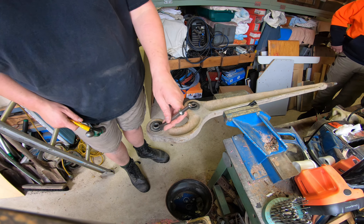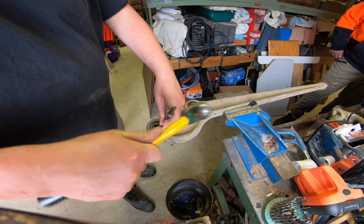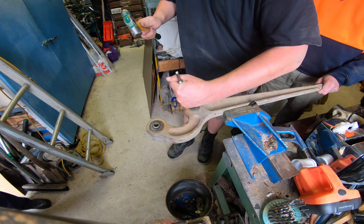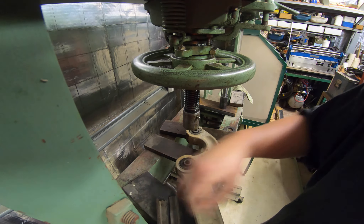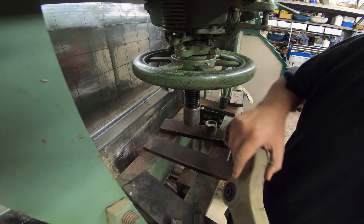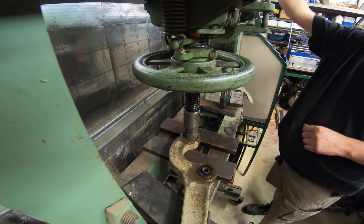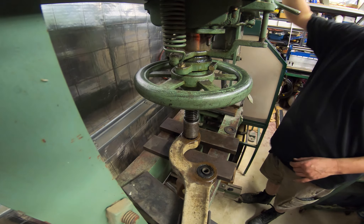We're in at the old man's workshop. I'm going to fold the top of these bushes over a bit - the sleeve on them - and try to push them out. I've got an air chisel here and I'm going to hit it with a hammer, because we don't have the right tool. I'm going to put these two bits under there to get it level, then flip it the other way up. It should start to rest on there now. There we go - two tons of press. There it goes, beautiful.